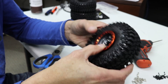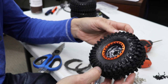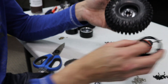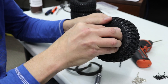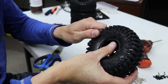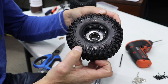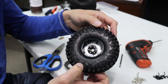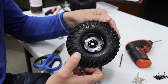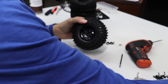Now with the finished rim — re-bolted after probably two hours — it just fits right in. Make sure the beadlock ring is sitting in the square bead of the tire, then on the back side get the back piece in, line it up, and all six bolts go back in on the inside. Wiggle it into the back of the rubber and push it down, making sure it's also sitting in the square edge of the beadlock seat. If the bolts aren't lined up, give it a bit of a twist, then put all the screws in.